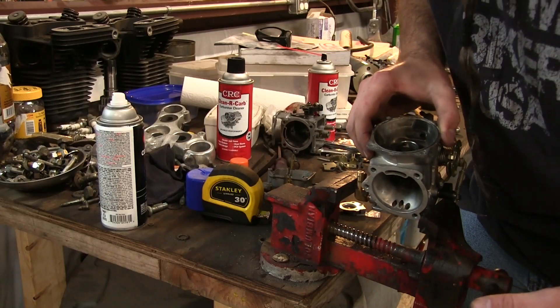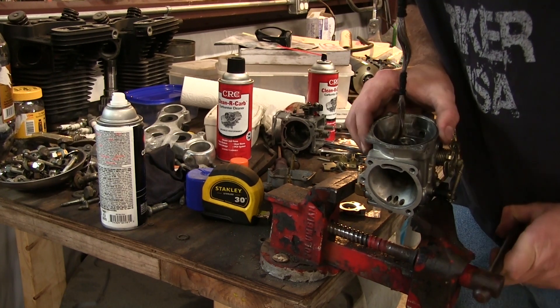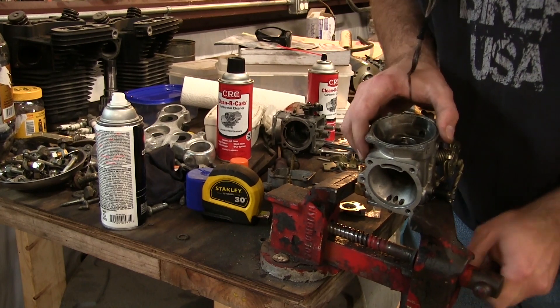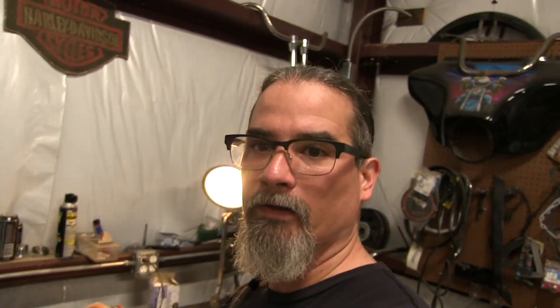Where is that carburetor body? There it is. It's only on the aluminum, so I just squeeze it and it goes in with no argument. And boom, there it is. Here's all the pieces, parts laying everywhere, and now to get all that stuff into this little body right here. This is the carburetor body that I used to install that intake manifold. The other one didn't want to agree with the installation that this one made, and I really believe that's a lot of what my problem was with it idling too high.